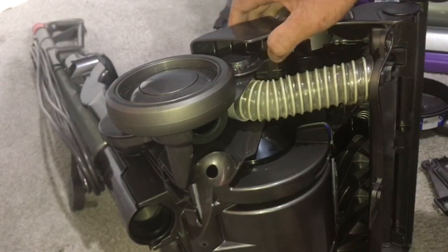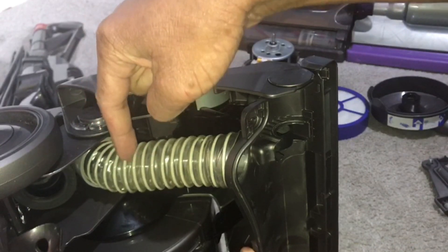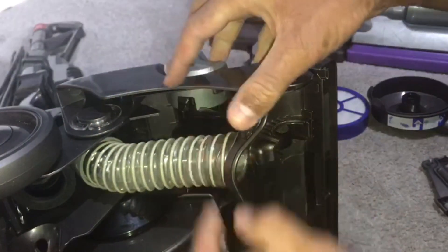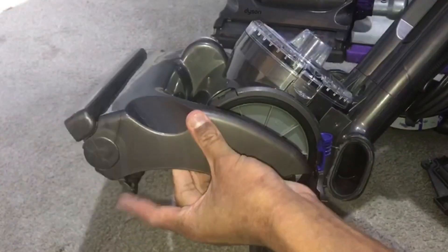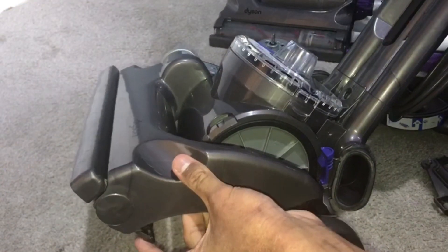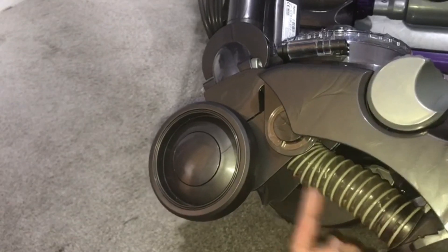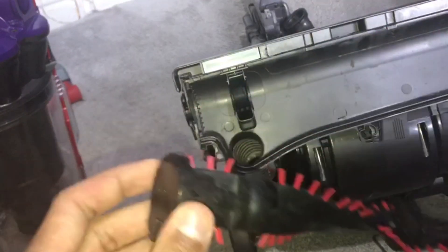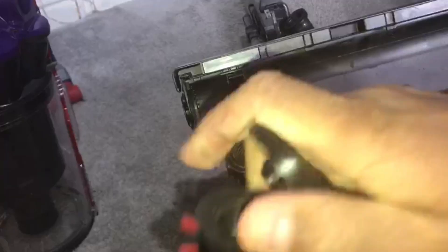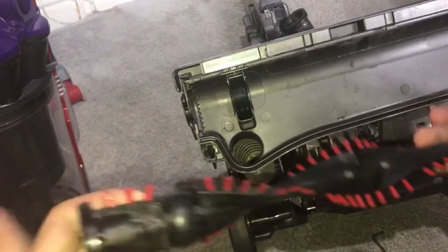Here's a trick to making your Dyson work better. This little hose — see these white coils inside — that is actually a spring. That spring pushes this floating piece and keeps it springy, which is what pushes the brush bar into your carpet. If it's not springy, you'll either need to wash this hose or replace it altogether. Check that your brush bar is clean and spins freely. If it doesn't, hold these end caps, twist, and check there's no hair in the bearings. Clean it from dust as well.